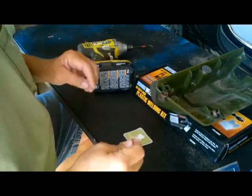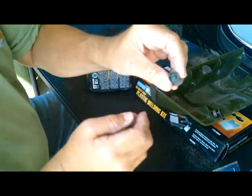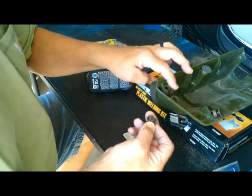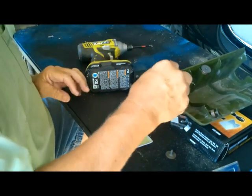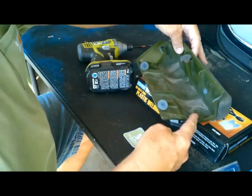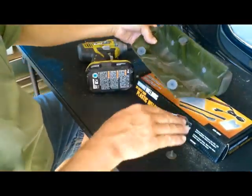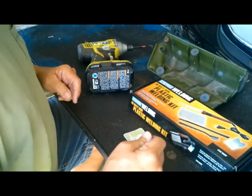So this is what I'm going to try to do — I took these off in the order they were on the back of the card. They've got the little pieces down in here that actually go on here. What I'm going to do is probably hot glue these back in there, because these are like little tabs — see that little thing — and it sits on there like that. For where it's broke from the door card, I'm going to try my welder. I've got a plastic welding kit, so I'm going to give that a whirl. Let's get this hot glue gun fired up.